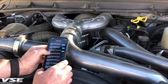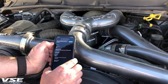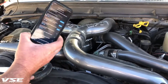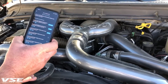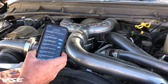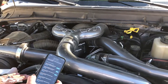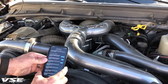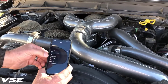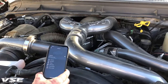We have tunes for fixed vane turbos, single turbos, 2015 turbochargers, and compound turbocharger setups like this truck. This cloud-based app pulls data from the web, downloads it into the EasyLink box, and imports it into the vehicle's engine control unit and transmission controller via the OBD2 plug. The EasyLink installs into the truck and takes about three minutes to flash both engine and transmission. Users with multiple trucks linked to one EasyLink box can select different trucks and install tunes using a single device.